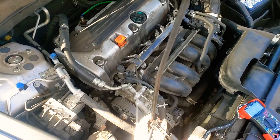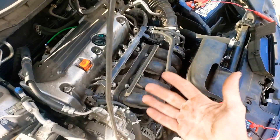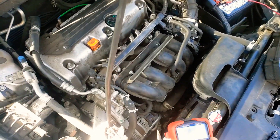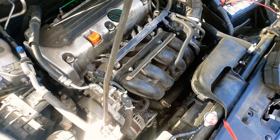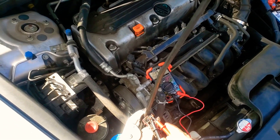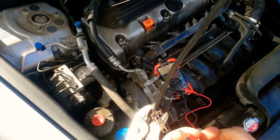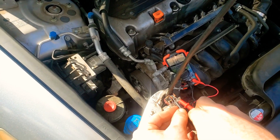What we did is we took our other relay — the new one. You're gonna wash, rinse, repeat and do the same procedure. We're gonna take our DMM, set it to ohms, and we're gonna check the resistance of the connection while it is activated. So look right now — nothing, right? 'OL' means over the limit, so that means it's not connected. We're gonna try and get your fingers in there like chopsticks and hold the probes on the relay terminals.